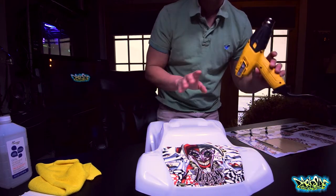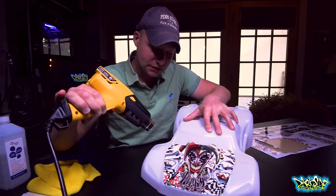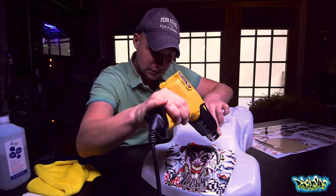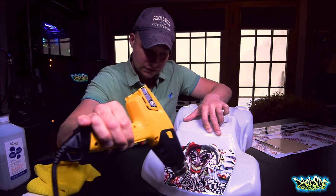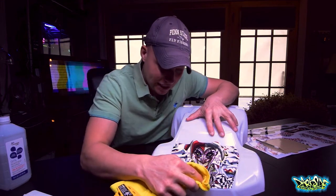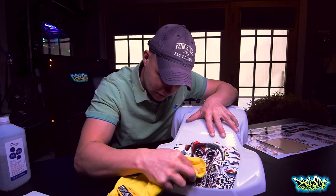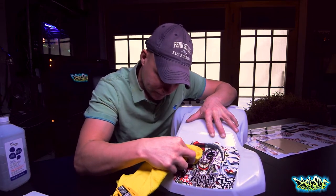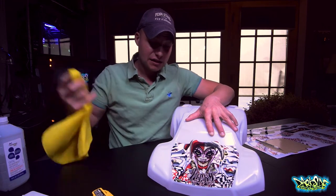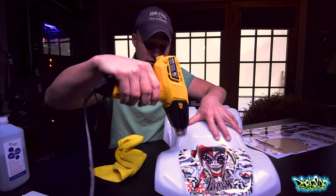Now, the next thing we're going to do — and you cannot do this without heat — we're going to turn our heat gun on and heat this quite a bit. Pay attention: see how it's starting to fold down now? It's going down on its own. I'm going to turn this off, take my rag, wrap my finger around it, and go right up the center with my finger just like that. Now I'm going to come back in a swiping motion, back and forth. This cools fast, so you need to add some more heat, and I'm going to come right up along here — and you can already see that it has bonded down over that big ridge.